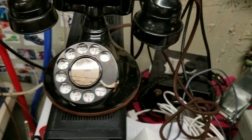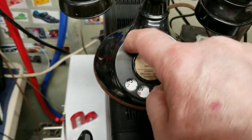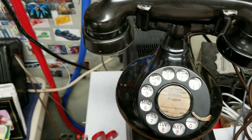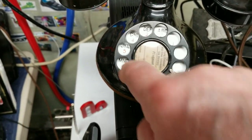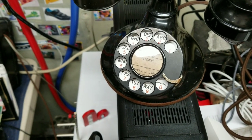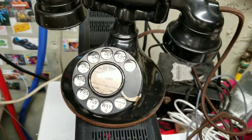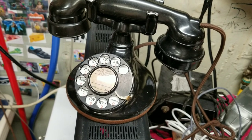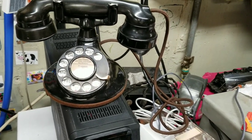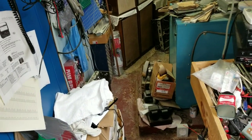You should not have a notch in the porcelain dial plate because you don't need it. This one is supposedly serviced but has obviously never been touched. You can hear it — beautiful click-clack — but also notice how raspy it is. It clearly needs to be lubricated. This is probably an as-is dial that nobody ever touched, or if they did, it was 50 years ago. It's almost a hundred years old.